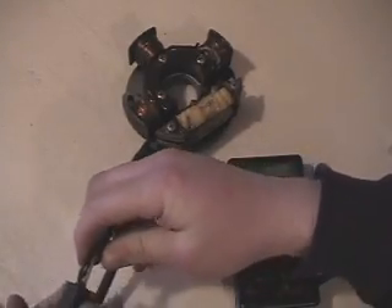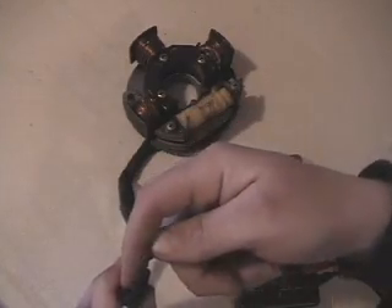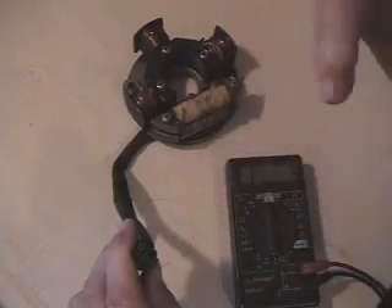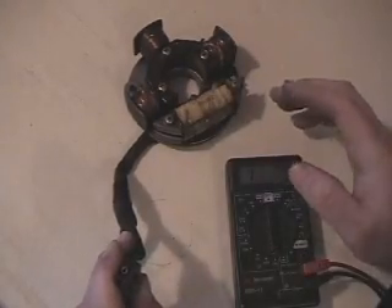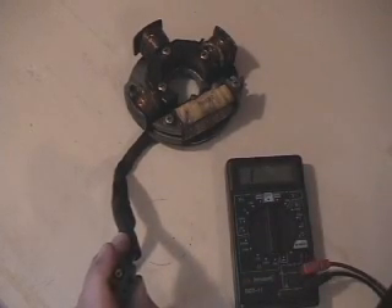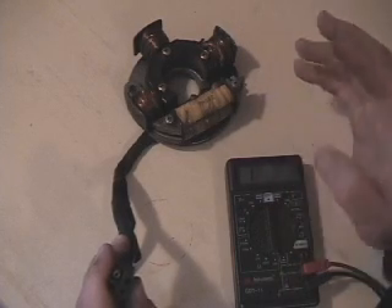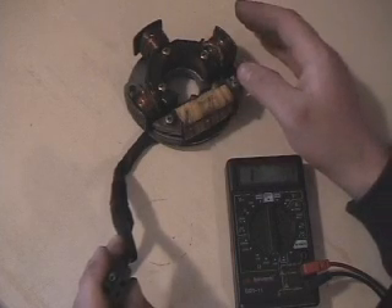On this unit, just find your two non-yellow connectors, which is always the male because that's our ground, and then it would be this one here. You just go ahead and take a wire, put it between the two, and you bypass your whole wiring system — you bypass all your gauges, your ignition, and the whole nine yards — just to check and see if your issue is in the stator, CDI coils, or the major components of your ignition.